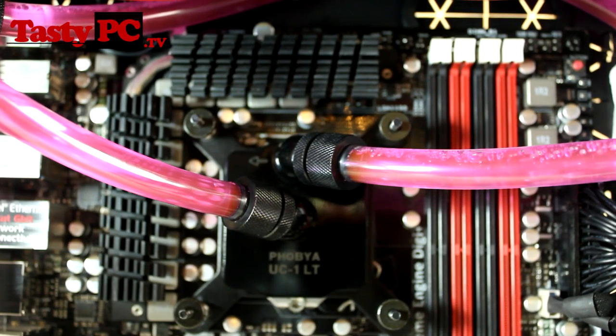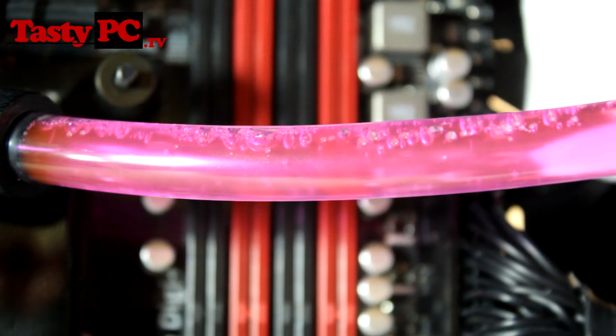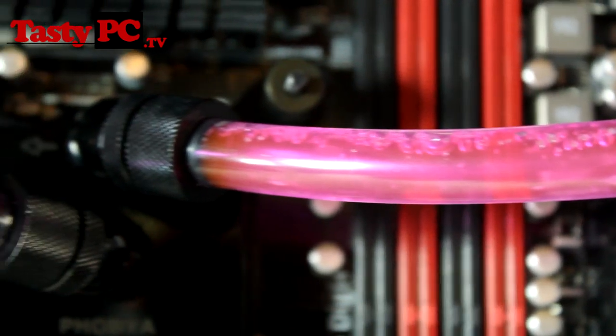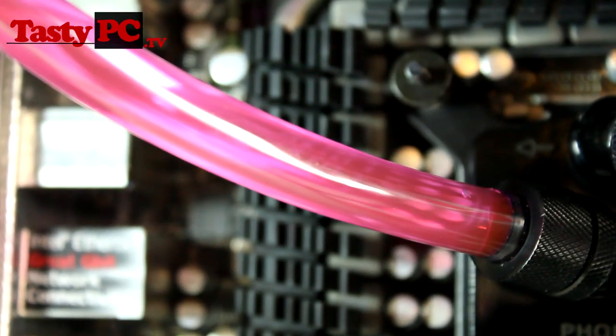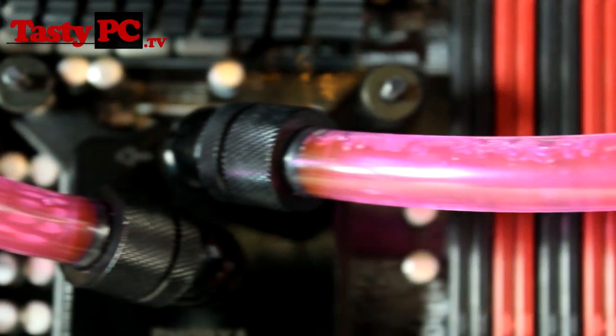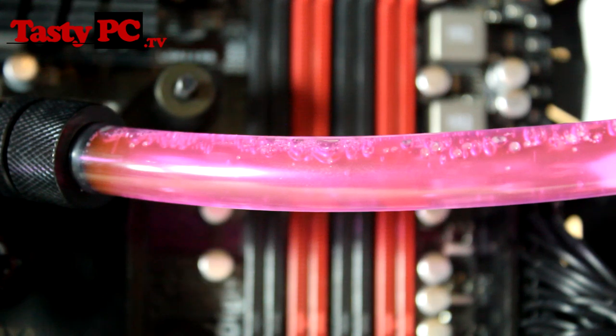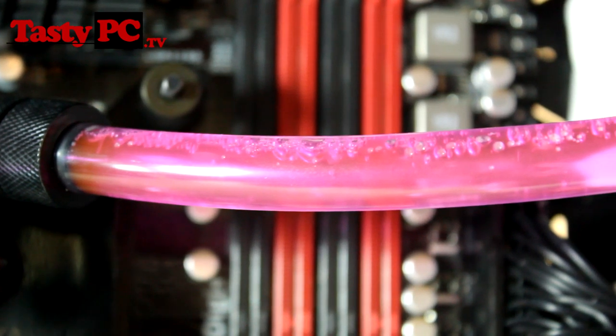I'm sorry for cutting the filling process short — my SD card ran out of space and stopped filming without me realising. I have now finished filling the loop, but it is currently full of air bubbles. The first thing I'm going to do to try and get rid of them is just turn the pump on and off, and hopefully that will move some of them along the tube. Air does normally always rise to the highest point, so you can tip your case backwards and forwards to move a lot of the air as well. Or if you're feeling brave, you can squeeze the tube a little bit. But the majority of bubbles will move on their own if you give it enough time. So I'm going to leave the loop running for around 12 hours — this will leak test it but also get rid of most of the bubbles at the same time.